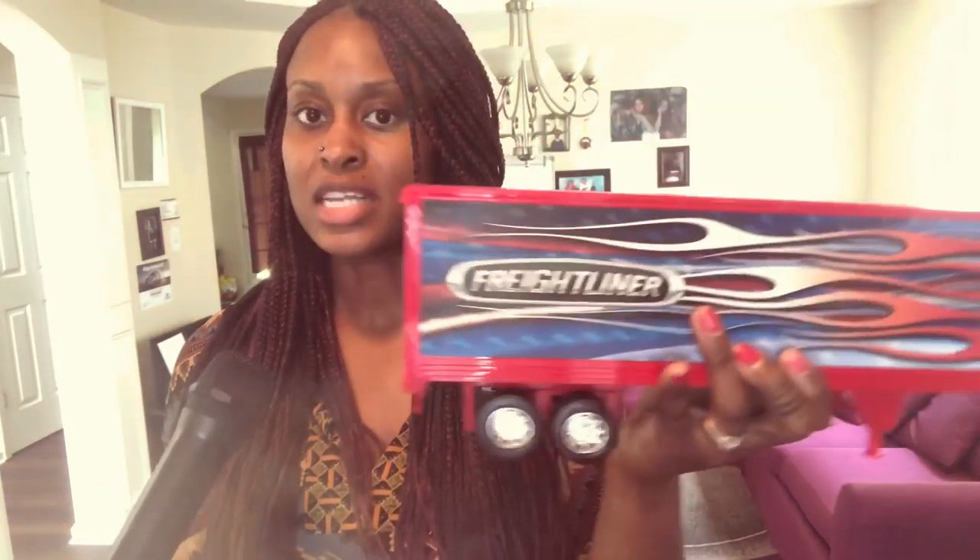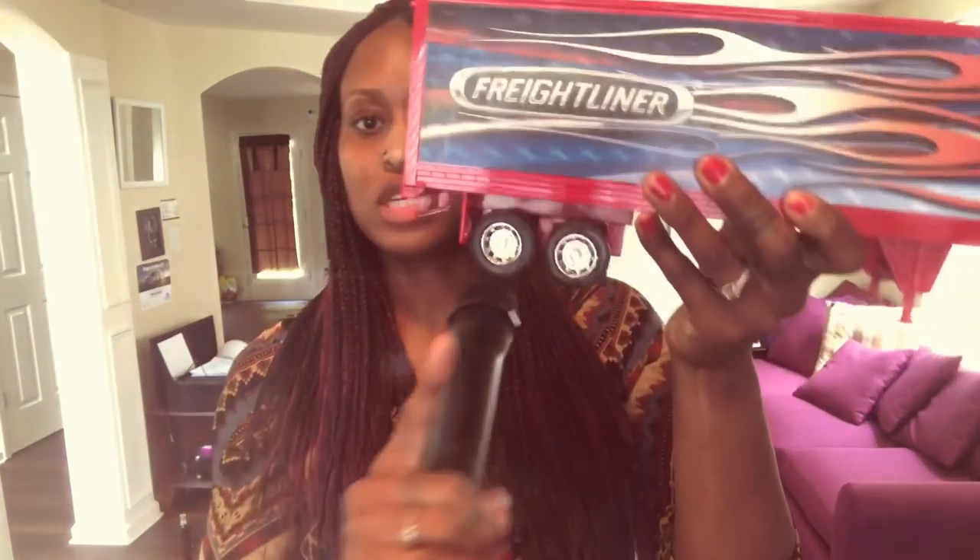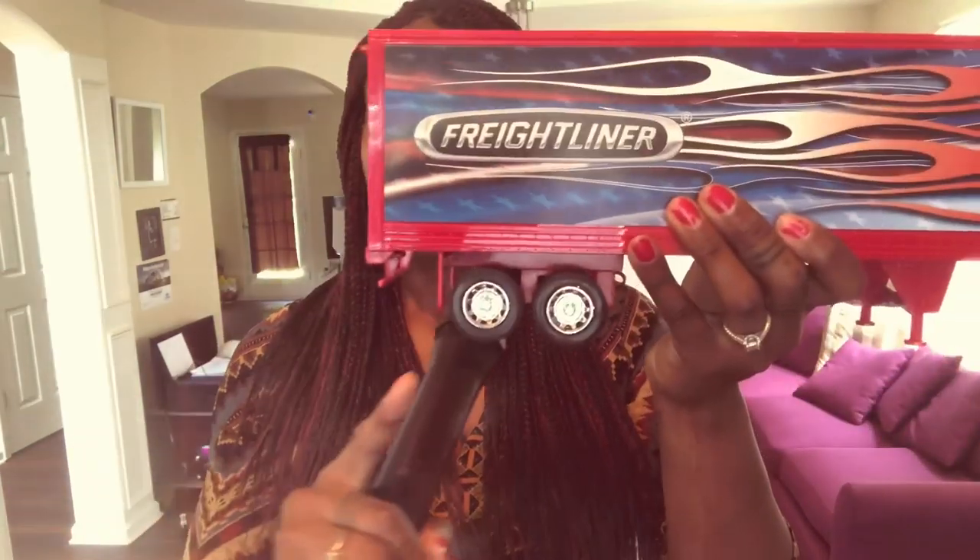Because to slide forward would mean putting your tandems all the way to the front of the trailer. And there's actually a science behind that, because when you slide your tandems forward or backward, that changes the dynamics and the science of the weight placed on the front of your truck and the back axles. Each set of axles has a certain weight that it's supposed to carry. You have your drives on your tractor, your trailer axles, and your front drives — each of those is allowed a certain amount of weight before you're in violation for being overweight.